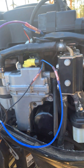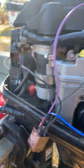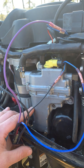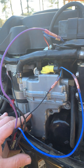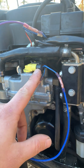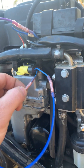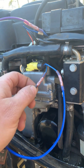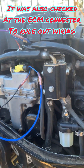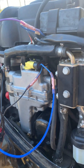Upon my diagnosis, the customer was thinking the fuel pump was bad because there was no fuel pressure at the Schrader valve. But I took the fuel pump out, jumped it, and it worked just fine. Originally I only tested the power wire coming to the fuel pump — it had power. What I did not test was the ground wire, and in this application the ground comes from the ECU. We had lost the ground going to the fuel pump, so I cut the ground off and grounded it directly.